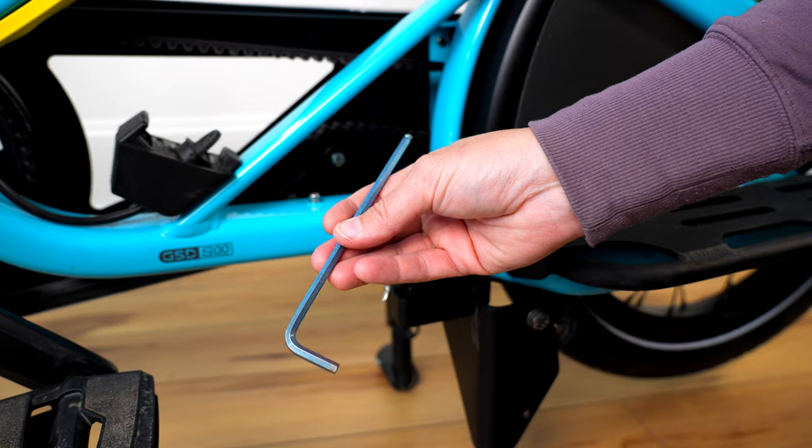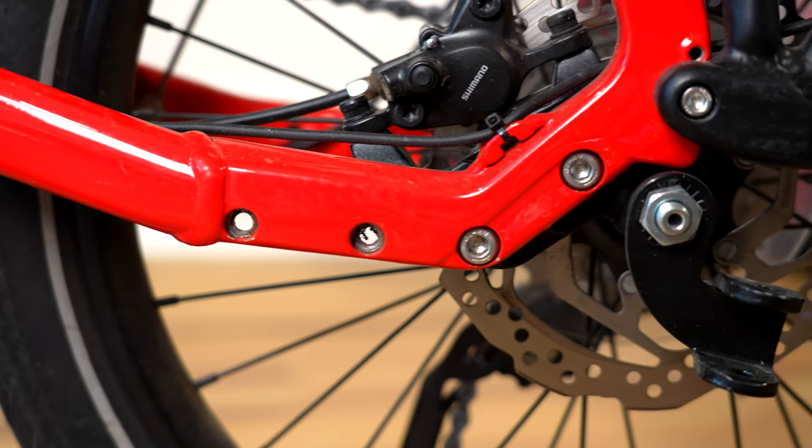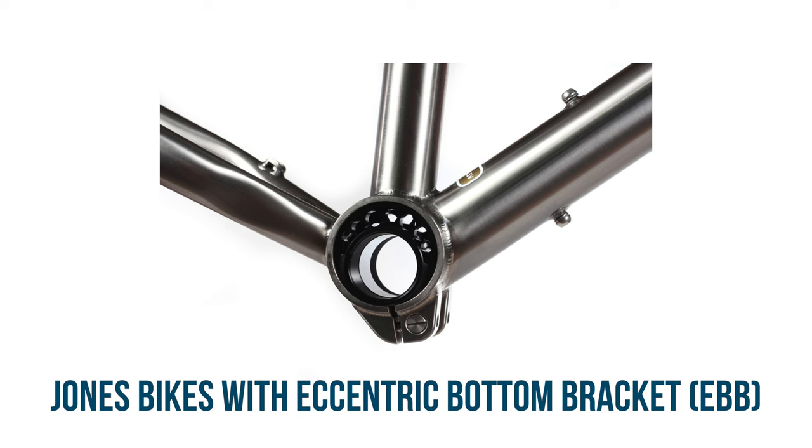On the GSD, it uses a tensioner which you push up and down to change tension. For the HSD dropouts, you pull the wheel back to tension the belt and push it forward to loosen — just make sure the wheel isn't shifting sideways when you do that, as it can pull to the right side when tensioning. The last way to tension a belt drive is typically with an eccentric bottom bracket, which is usually on a non-electric bike. That's where your bottom bracket shell can actually rotate in the frame — a super special frame to allow this. You're just going to be tightening or loosening, checking again, tightening and loosening — trial and error. With time, you'll get a good sense of how tight the belt should be.